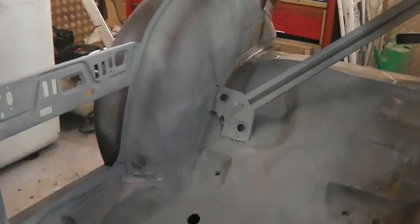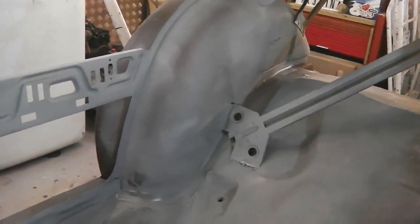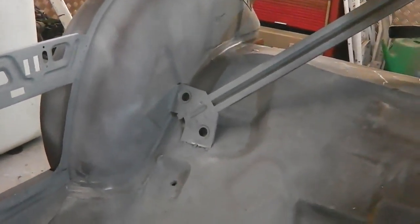Tar pads next. Here we go. Well, we're out of time for today, otherwise I would have carried on, but what I want to do is let the seam sealer cure itself, because when the tar pads go down, you don't want to squish the seam sealer, you want the tar pad to land on hard seam seal, so it semi-imprints in, and also you want a slight imprint of that biscuit. There's the biscuit I'm talking about, it's a floor bung, we call them little biscuits or Trivial Pursuit pieces, or orange segments, whatever you want to call them.